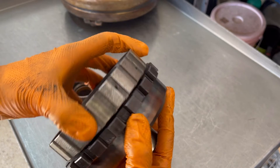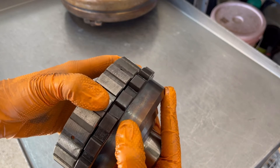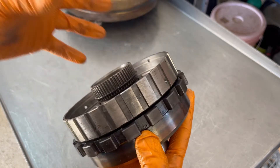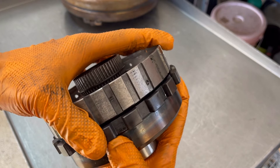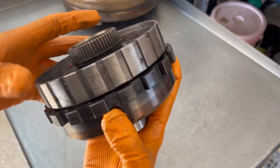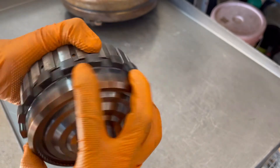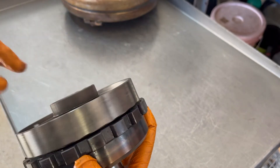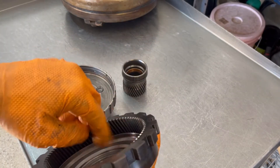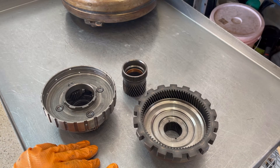When these gears are trying to mesh together, if a piece of gear tooth gets lodged in there, it will seize up — essentially like sticking a stick through the spoke of a running bicycle wheel, and it just locks it up. Oftentimes you'll have to throw the vehicle either out of reverse or into drive, or vice versa, and then the carrier will stop spinning in the opposite direction, which will free up that piece of gear tooth wedging itself between the planetary gears and the ring gear or the sun gear.